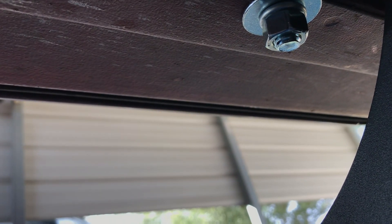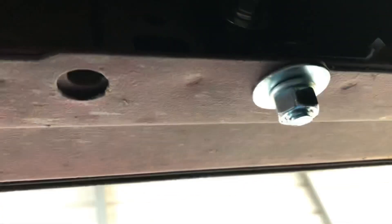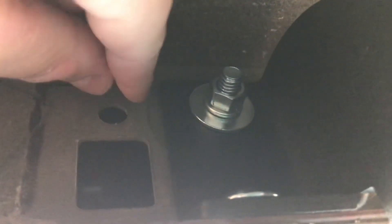The confusing part was the middle bracket. It says on 2009 and 2010s only you have to use these, but my truck didn't have these on the stock steps - it only had a mount here and a mount there. They really need to change it to say 2009 through 2014. I had to peel back a little piece of plastic to reveal a hole. There's a piece with a stud - you slide that into the hole, add a rubber or nylon spacer so you're not rubbing metal on metal, then a washer, lock washer, and nut.